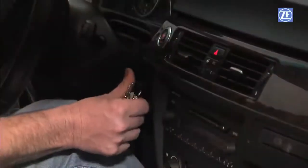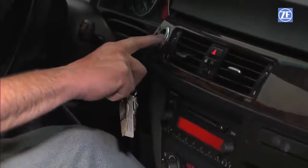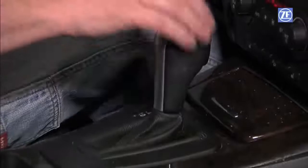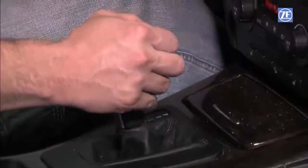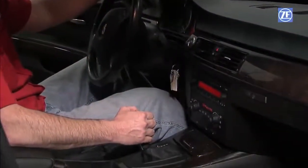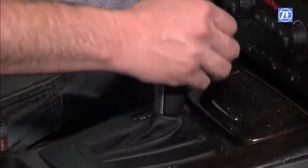With the car safely secured on the lift, start the engine and briefly let the new fluid circulate through the transmission. With your foot firmly on the brake, put the transmission in reverse, followed by placing the vehicle in drive and manual shift up to third gear. Do not allow the drive wheels to spin. Put the transmission in park and apply the parking brake.